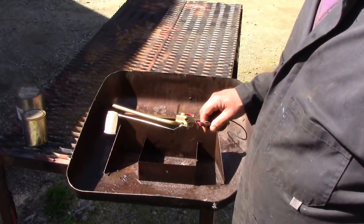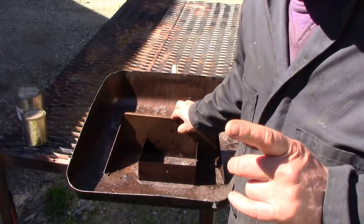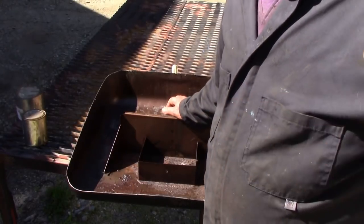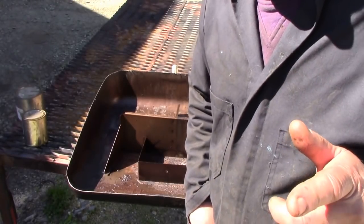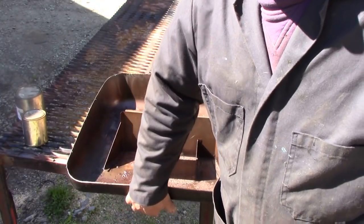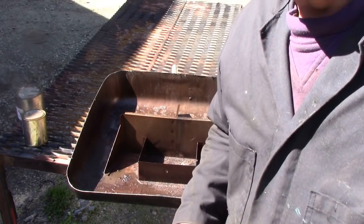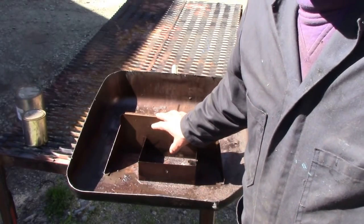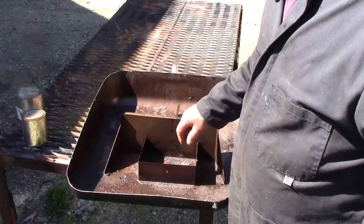Now, what I wanted to say was, if it weren't for that baffle, then yes, I would have a go at cleaning it and stuff like this. Many years ago with my Series 1, if you can remember from last week, the series tanks were renowned for leaking because they had a steel plate around the bottom of the tank, like a shield, soldered or welded onto the bottom, and water used to get in and corrode the bottom. But they had no baffles in the tank, so you could wash it all out, things like this, but what did you do for sealing it?